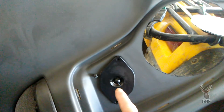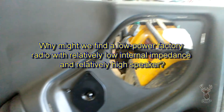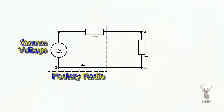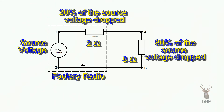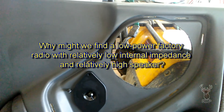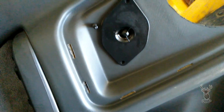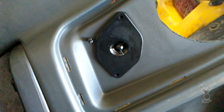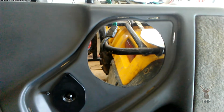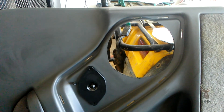So I'm going to leave the tweeter unplugged. I have a nice big six-and-a-half-inch speaker coming in compared to the five-and-a-quarter that was there. That way I can get both maximum power and 50% efficiency — not the greatest, but certainly better than 33% efficient. I think leaving that old tweeter disabled and going to one speaker will give us a little better output and more power transferred.